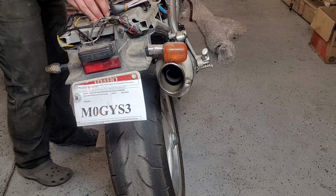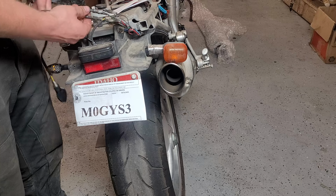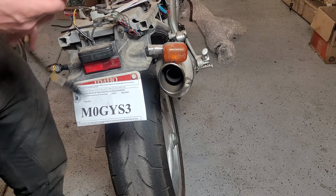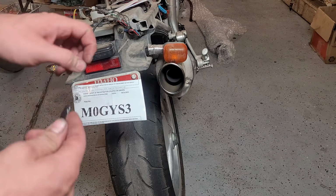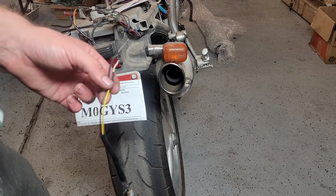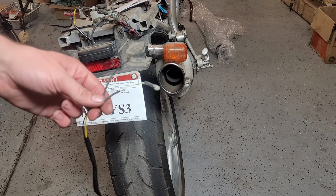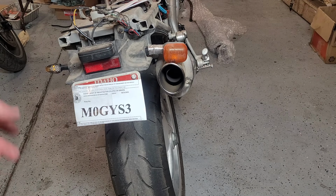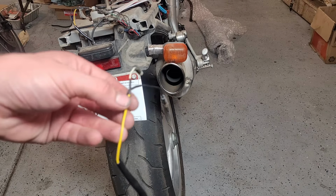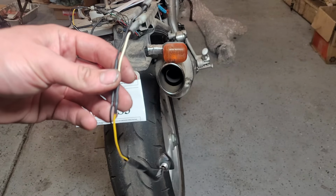Same thing. Yeah, it kind of blinks when you flip the switch, but it's not doing the right thing. So I think what we gotta do is put a load resistor in, up here, and I think we'll go with like 6 ohms or something like that. Kind of annoying. You go with LEDs, which use way less power, but it doesn't work right without drawing a bunch of power. There's signals, they're not on that much, so no big deal. I'll go solder a load resistor on here.